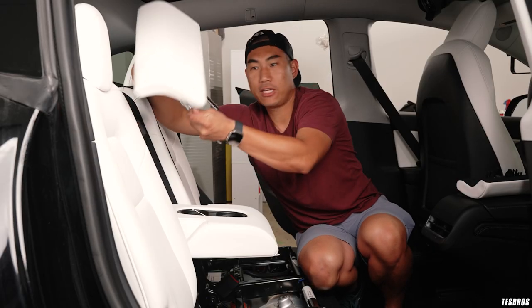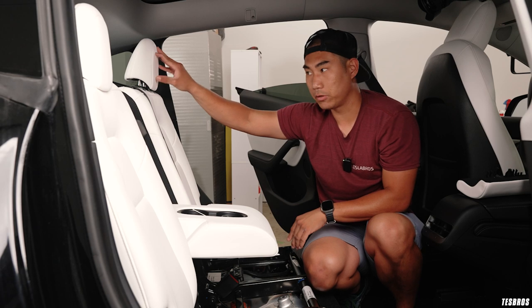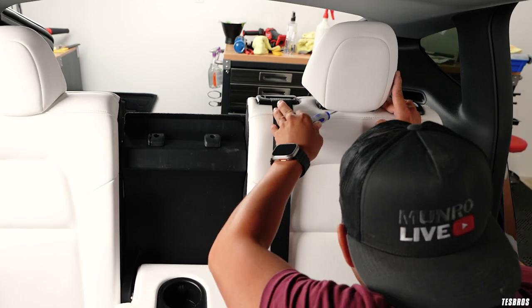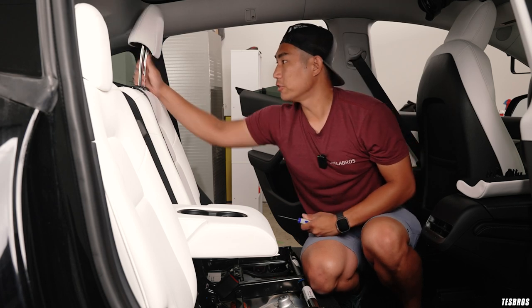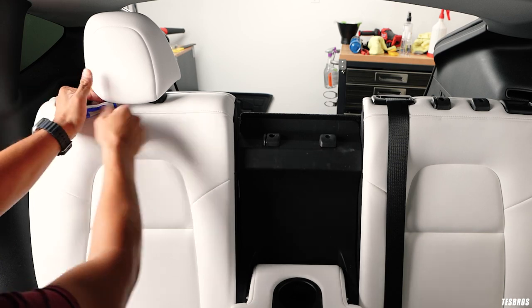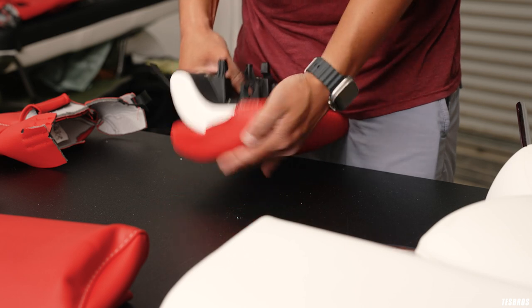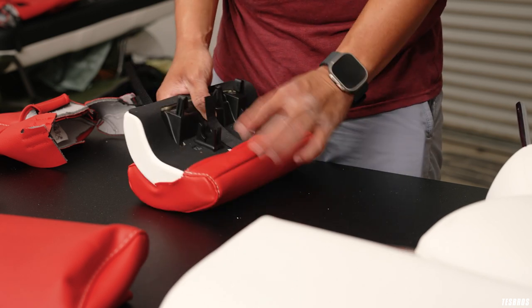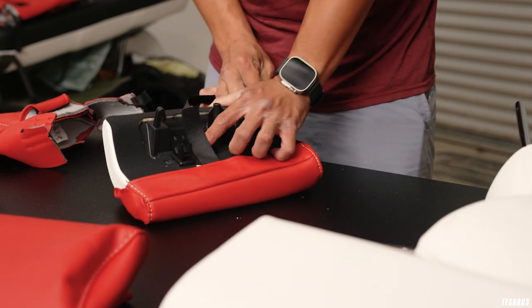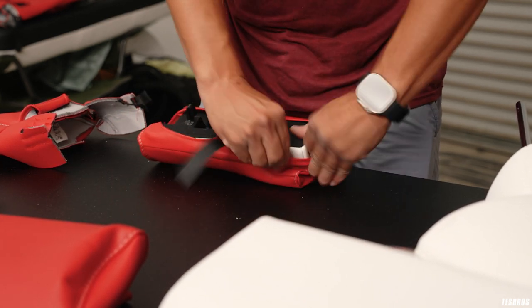Once they release, it's free and comes out very easily. The headrest is going to be exactly the same — this is the highest it will go unless you release the whole thing. Once you have it, gently push it into this area, hold it down, and it will come up. For the center piece that goes underneath, start from the bottom and you'll see a little tag — that's where the two plastic clips are, and it's a very tight fit.